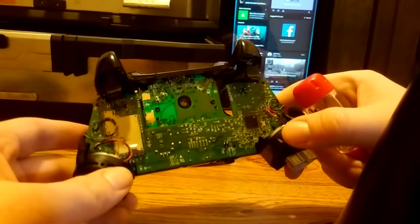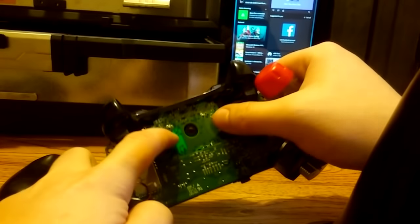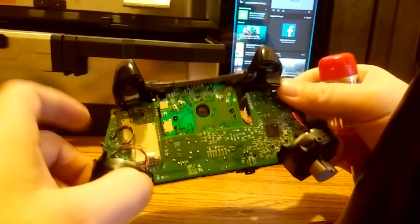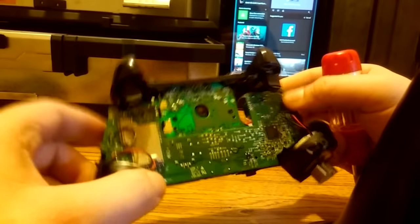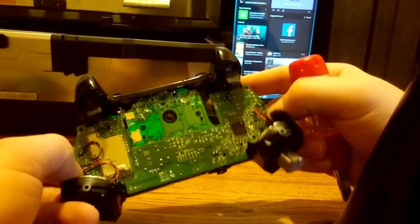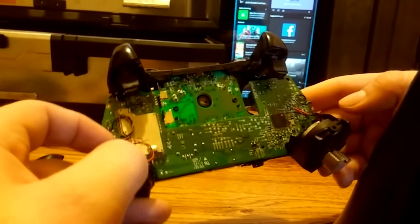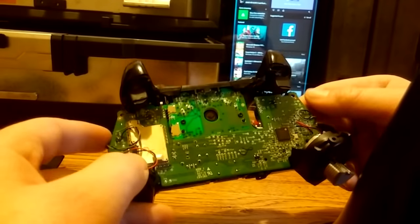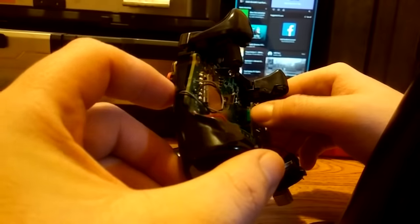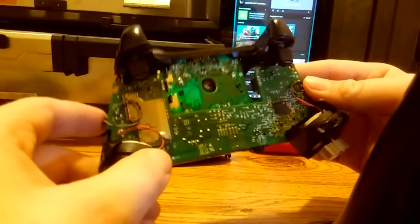You're going to need to remove the screws by the motor — the screw right here and the screw right here. You really don't have to mess with the others; that's only if you want to completely disassemble and clean the entire thing. If you have a lot of dust and the controller is really old, you can remove all of them and separate both motherboards for a detailed cleaning. However, for this solution, you just need to remove these two screws — the two on the far bottom right and far bottom left — to separate the top circuit board from the bottom and get down at the joysticks to adjust them manually at an angle.